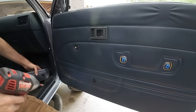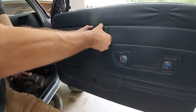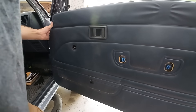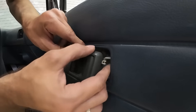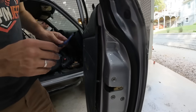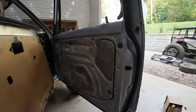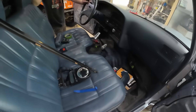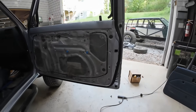You take the door handle off and take the screw out of there. Typically this thing pops up and kind of slides off - you can either push this through or pop it off. You come in and pop all these little clips from the corners, and then hopefully this will slide right off. There we go. Mine on this side hasn't ever been into - yours hasn't been into either. Well that's a shame, because we're going to have to get into it.